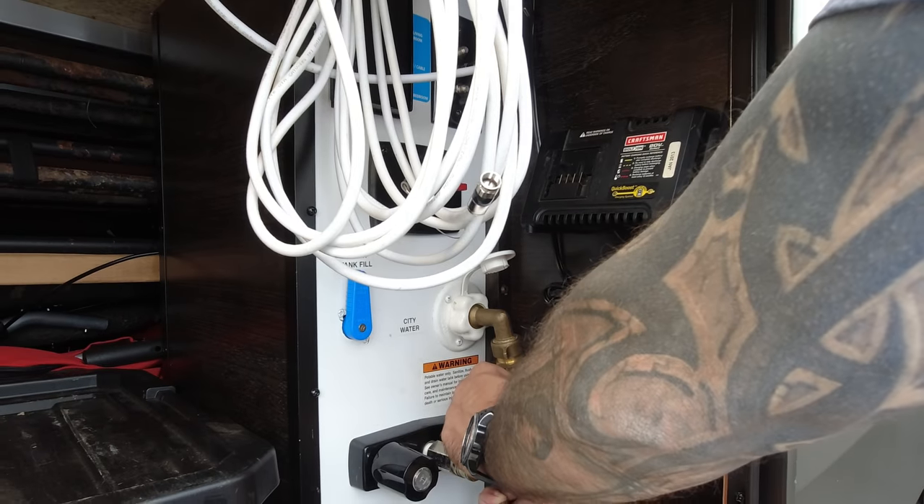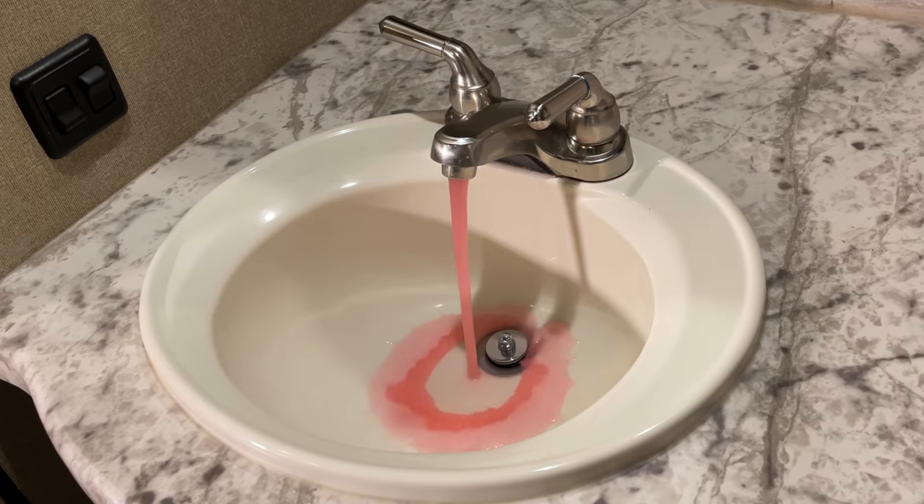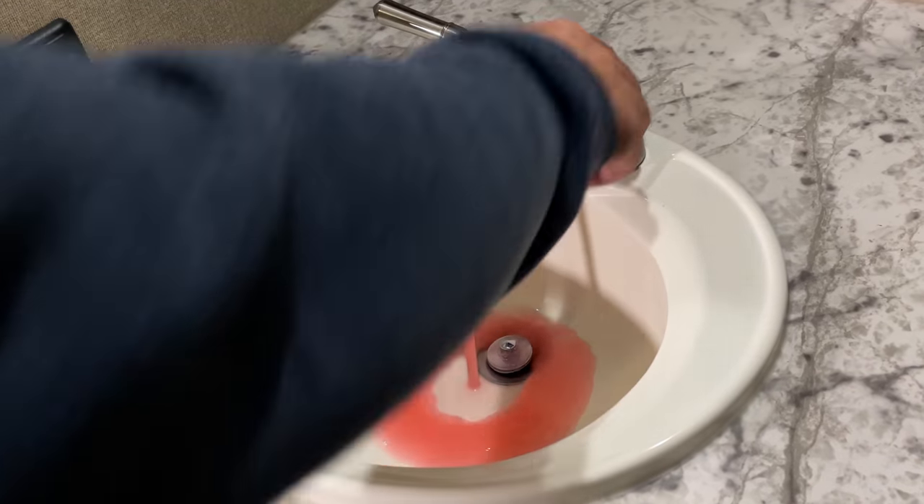I think the last thing that's worth mentioning is the confidence level of using each method. You can absolutely winterize with compressed air successfully and not have any issues after you de-winterize in the spring, but blowing out lines will never get all the water out of your plumbing system. Droplets are going to remain in the plumbing lines and you're going to need a lot more pressure than your lines and fittings can handle to get all of that water out. The key to using compressed air properly is making sure number one, you blow out every line that sees water during the camping season, and number two, you blow air through that line until you see all the water that's going to come out, come out. With antifreeze, you see the antifreeze come out of the faucet, so you know that all the water has been pushed out and you know that there's antifreeze in that entire line. That assurance is probably the main reason why people who use the antifreeze method choose that method. It's not my job to convince you one way or the other, but these are the things people are talking about in winterizing discussions.